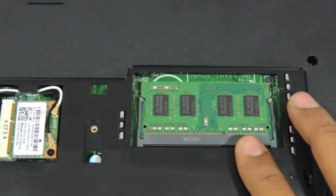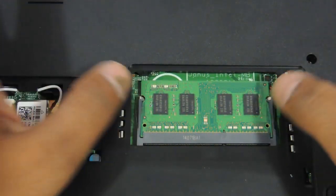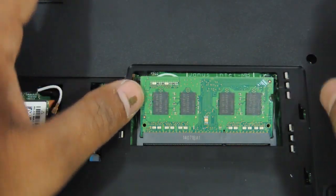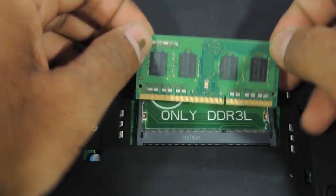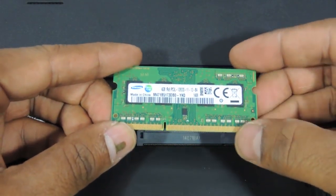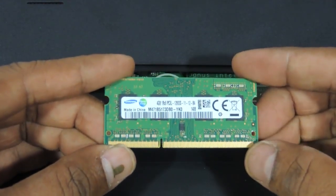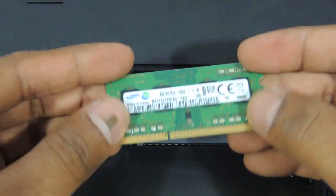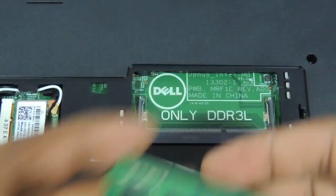This is the RAM slot area — we have zoomed in and you have these two notches, one and two. Just use your two little fingers and very gently pull it aside and the RAM comes out. The DDR3L SO-DIMM memory comes out. You need to very specifically use a DDR3L RAM — for all 4th generation laptops you need DDR3L; a normal DDR3 will not work with it.